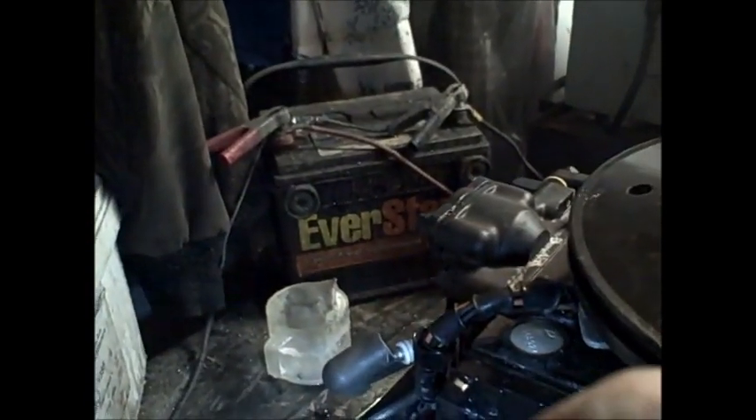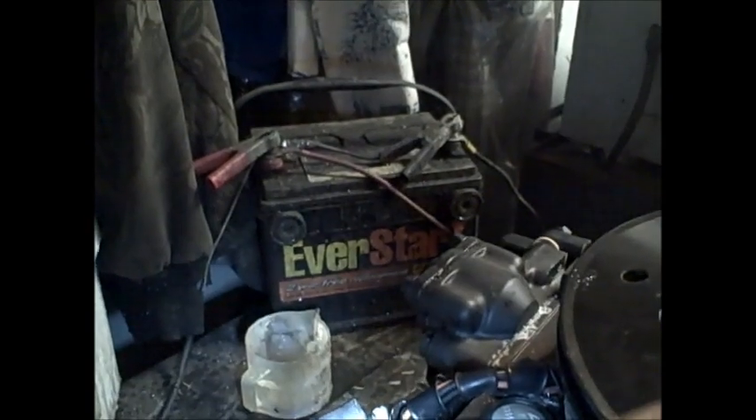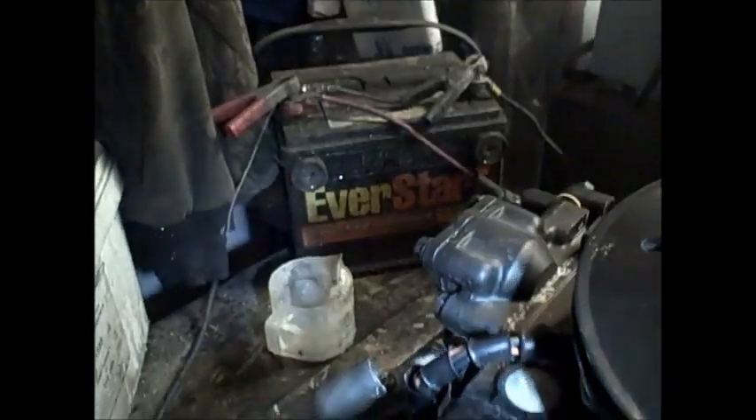You can see I had good hot spark all the way to the end of the spark plug wire, but when I pulled off that top wire the engine dies. So she's only running on that top cylinder.